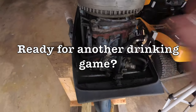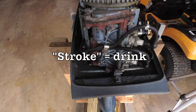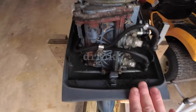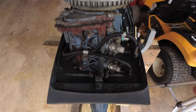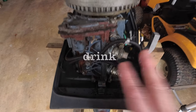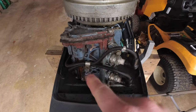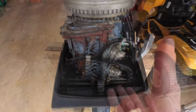The Fisherman 6-horsepower motor is a 2-cylinder, 2-stroke engine. Car engines and a lot of other larger engines are 4-stroke engines. A lot of newer boat engines are 4-stroke engines. There's a lot of technical differences between a 2-stroke and a 4-stroke engine. Essentially, it's called strokes because in a 4-stroke engine, the piston has to go up and down 4 times to complete a cycle, and in a 2-stroke, the piston only goes up and down twice to complete a cycle.